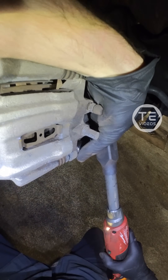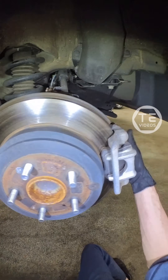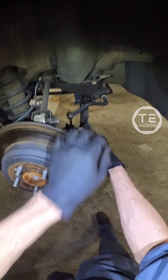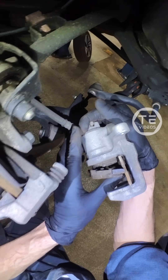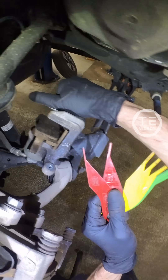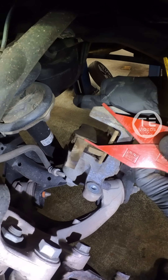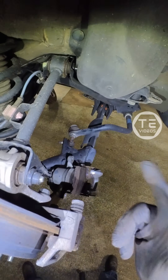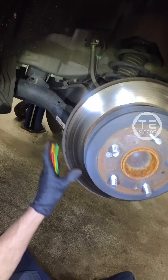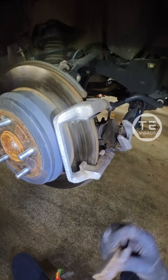Come on out, don't be shy. Shimmy shake, some persuasion here. And that's looking like about a 2.5 milli as well. So we're going to give an option to replace the front and rear pads and resurface — assuming the rotors are thick enough, and they sure look thick enough.